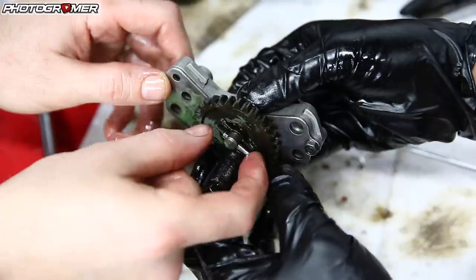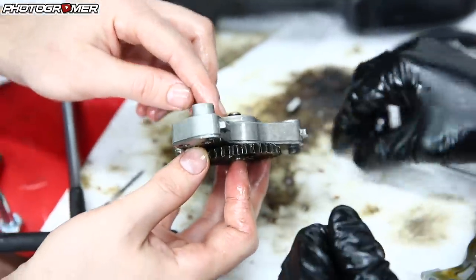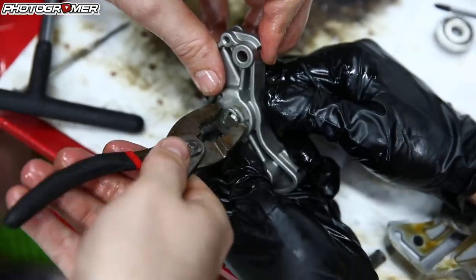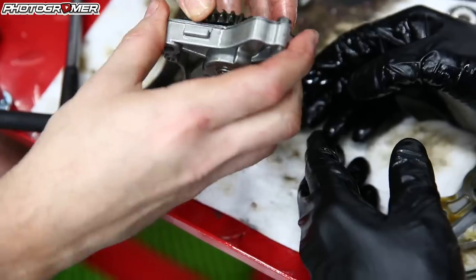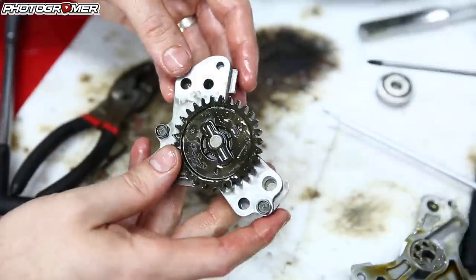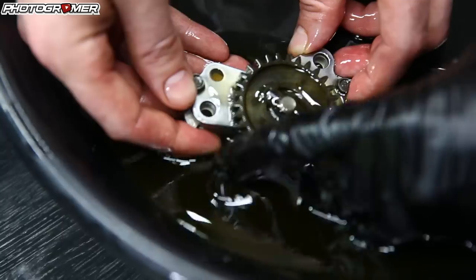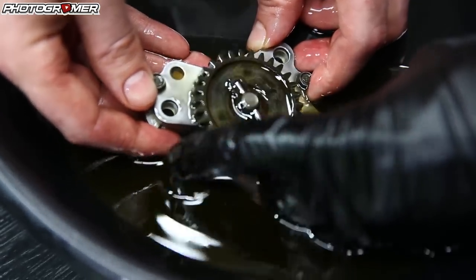You can spin that. Now we're left with this little slot where our C-ring retainer clip goes right back in. Now we're just going to prime her, make sure she's pumping with some oil — it's starting to come out the top. There it is. So you know that's primed — we have oil.